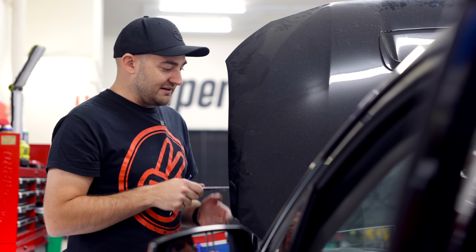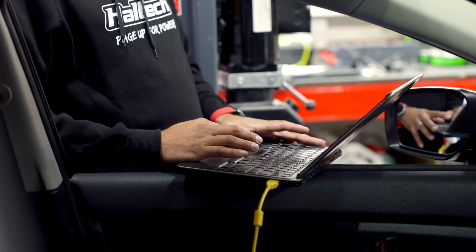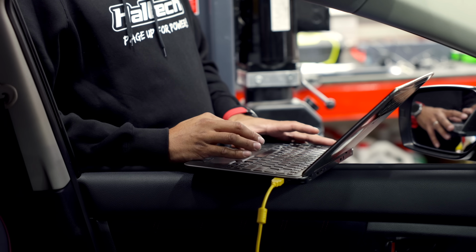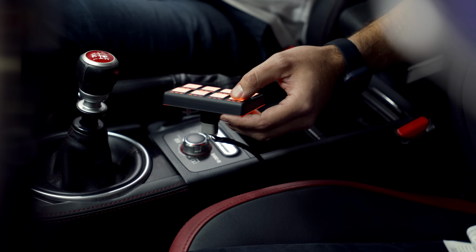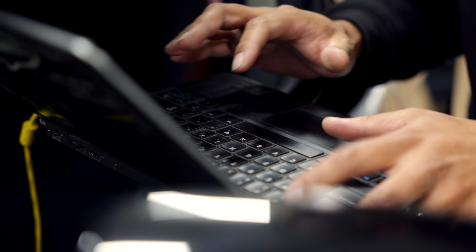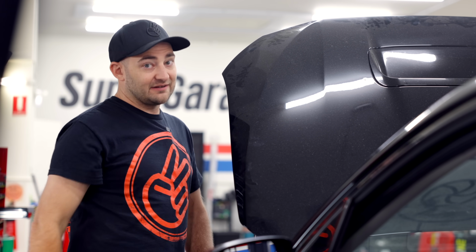So what does that mean? It means now I'm going to set a fuel pressure regulator on one pump. Dave's going to disable the second one, and only once we're on the dyno with Tuning Fork, with Scotty, we will start to think about introducing that second pump where required. So to drive around most of the time won't be needed. When you really hit it full boost, high revs, bang, the second pump will be introduced. So that's what we're going to do.